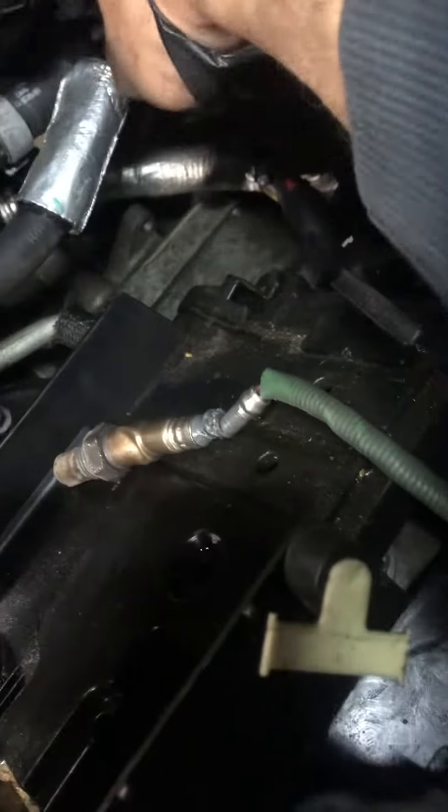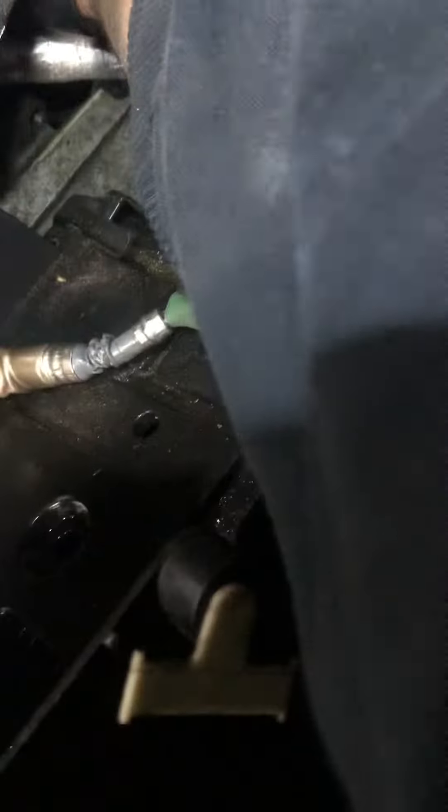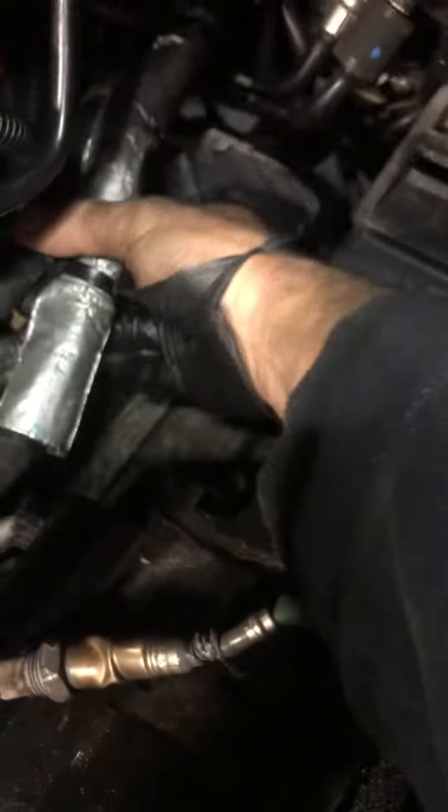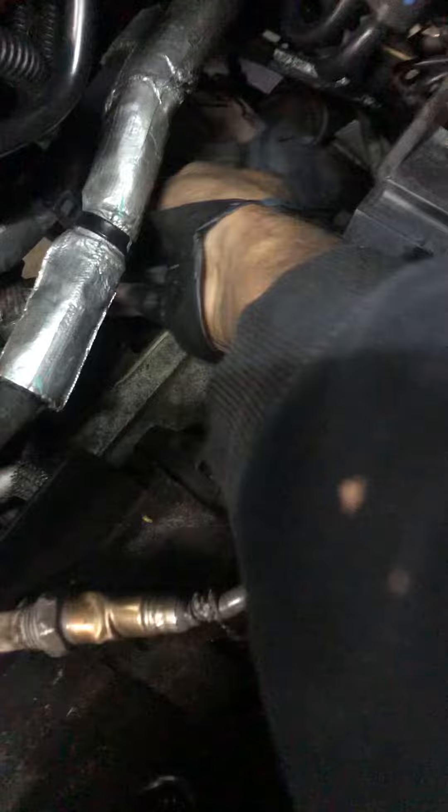Then you will have your room. Stick the extension through here with the tool — right down there onto the oxygen sensor. You'll feel it. Then run your extension between here; you might want to loosen these up — this one's got a zip tie on it. If it doesn't have a zip tie it's easier — stick your extension right through there.